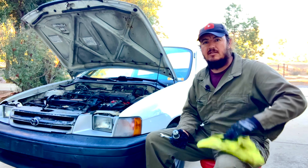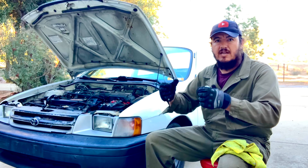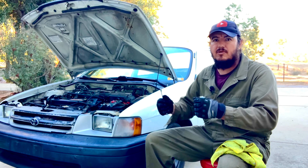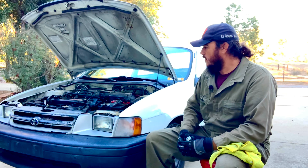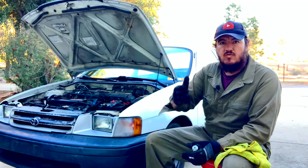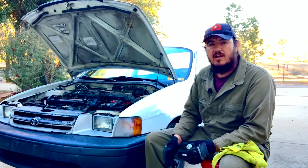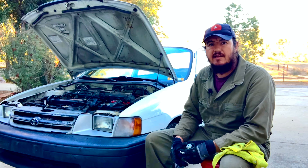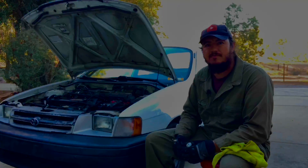All we did was use a wrench to loosen the connections and take them off, clean them with a rag, then use the wire brush for the terminals — so you start with fresh, good contacts and all the electrical runs well. For those who watched and haven't subscribed, please subscribe. If you liked this video give us a thumbs up, share it, and we'll see you soon with more videos here on El Chano Jose.